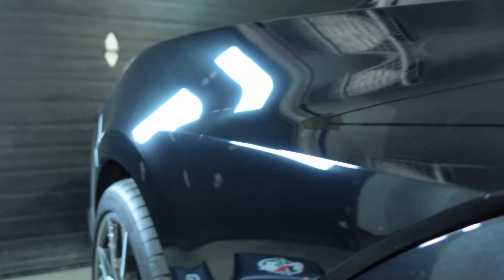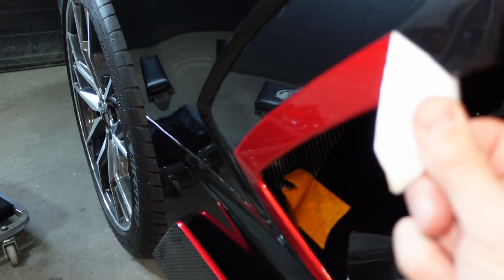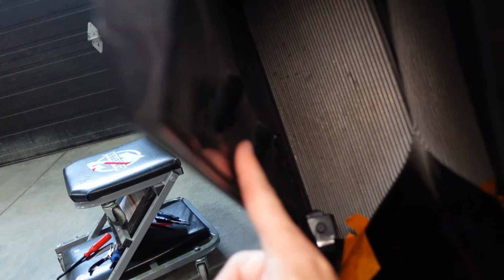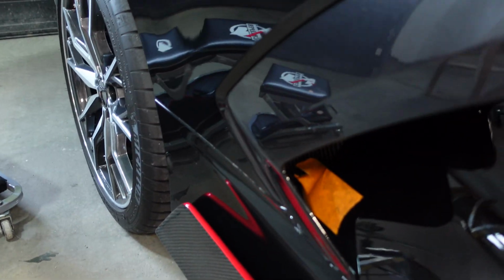That's it. I'm just gonna take this vinyl off here. Probably confuses you more than anything. Now, if you feel inside this edge, you can actually feel some double-sided adhesive tape. So we're just gonna heat the panel up a little bit and then use our pry tool to get that to stop adhering. And then we're just going to pull this off.